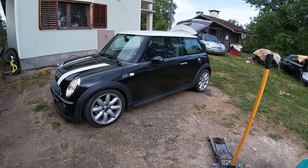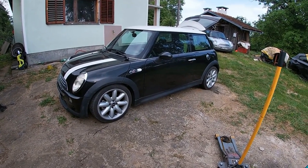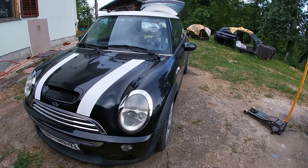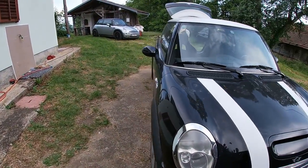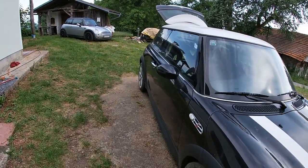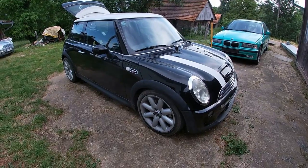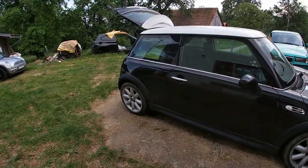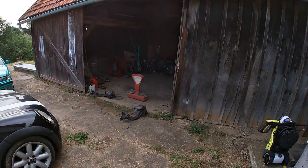All right, we are done. Trailing arms are on. Everything is tightened up. Brakes are bled. Only thing we didn't do is toe adjustment. And I have a lot of toe in, to be honest. You cannot see that on camera, but I can see it here. We will set that back to zero. Fronts to zero. Around 2 degrees camber in the front. Whatever we got on the rear, it's done. This caliper's all in. The difference, 2.4 kilos.